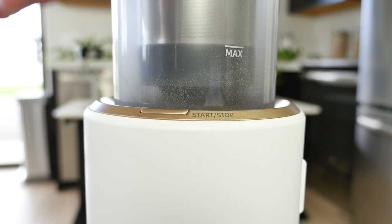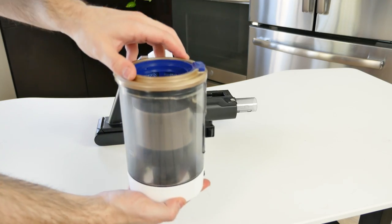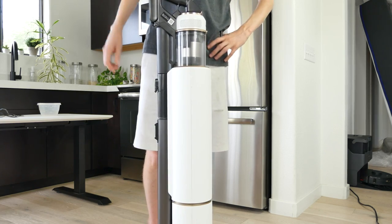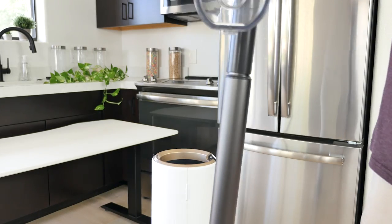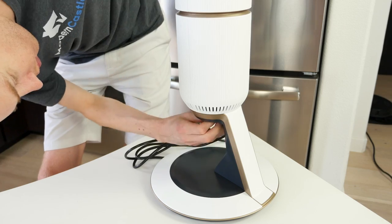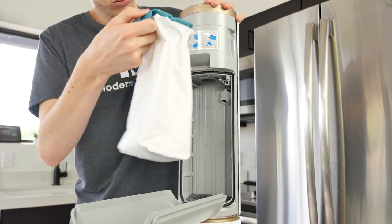In addition, there is a button on the clean station itself that starts and stops a self-empty cycle. Overall maintenance for the Samsung Bespoke Jet Vacuum is excellent. This is largely due to the clean station — it takes care of the most frequent maintenance task, emptying the dustbin. When the vacuum is placed on the dock and the self-empty button is pressed, the station will empty out the dustbin into an internal dust bag. However, there was one issue we experienced: after self-emptying, the dustbin would remain open, requiring the user to close it. It caught us off guard the first time as we turned the vacuum on with the dustbin open. Other tasks, like washing the filters or replacing the dust bag, will need to be done by hand, but less frequently.